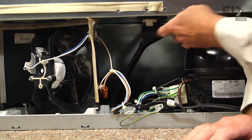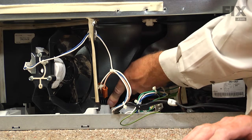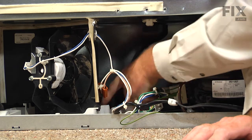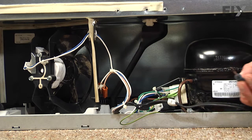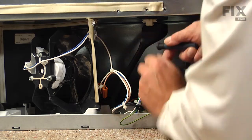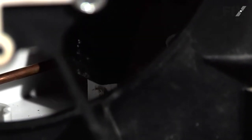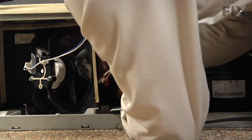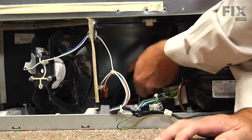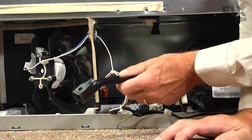So we'll need to remove the old drain — it is attached to the base of the drain pan and there's a little catch on the back side of that that you need to depress with your flat blade screwdriver before you can release that. Fit the screwdriver down into a little opening there, you'll see that tab, just depress it while pulling up on the drain and pull it out and set that aside.